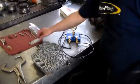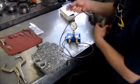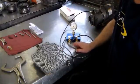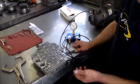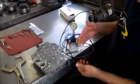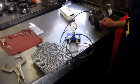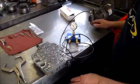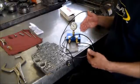Now that it's calibrated, we take out this piece that screws in here — this plug block with the hole in it — and take the hose and plug it in. The thing with vacuum testing is there's really no guide to say what's good or what's bad. You have to keep a log of what you do and compare it. I know with these, when I vacuum test this bore, it's normally about 18 inches. To me, that is good. Anything below that, the bore might be worn. But again, there is no good-or-bad chart — as you do this you should keep a log and compare.